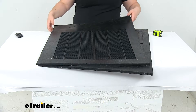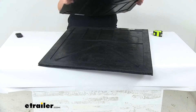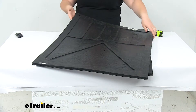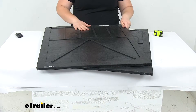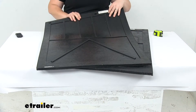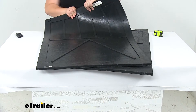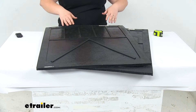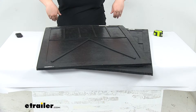That's going to be on one side. We do get two flaps and they're both the same design. These are really nice, thick, heavy-duty mud flaps. They're going to resist any kind of cutting or tearing. They're still pretty flexible, so it's not a bad idea to grab an anti-sail bracket so they don't catch the wind and just kind of flip up.